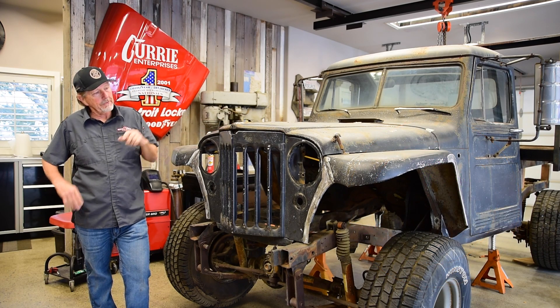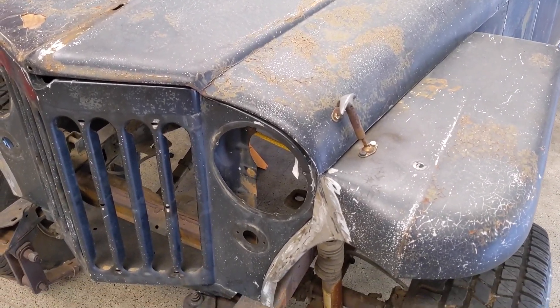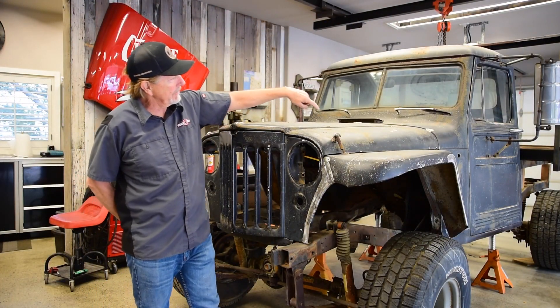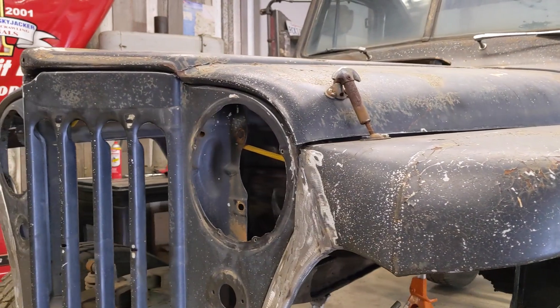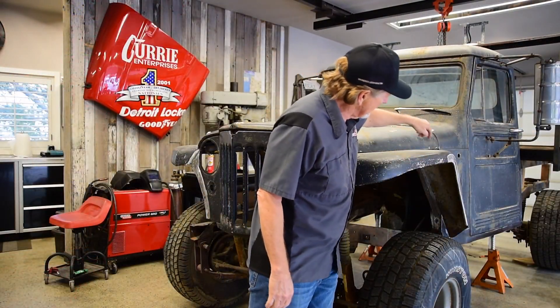So we're looking at the front fender here. This was actually one of the first things I started on. I was looking at this truck and thought this would be a perfect candidate to raise the front fenders because of the body seam on the side of the truck. If you measure from that seam down to the top of the fender, that was exactly four inches. So I basically took the fender off, cut it, and raised it on the notch.